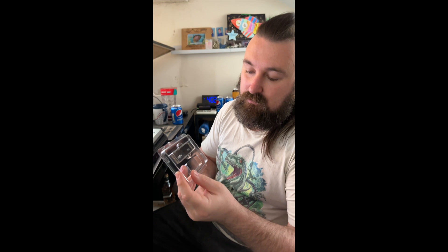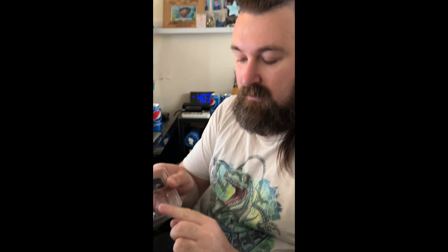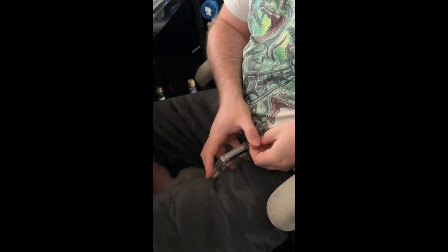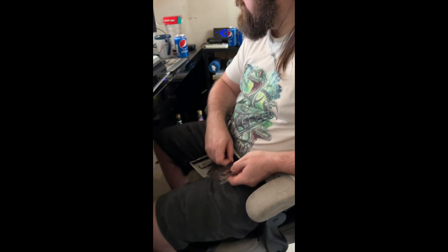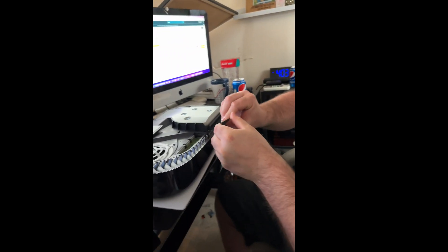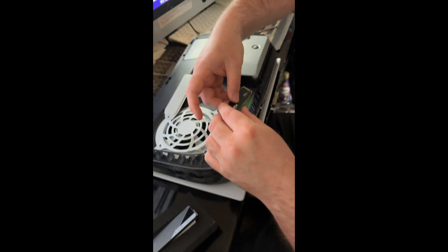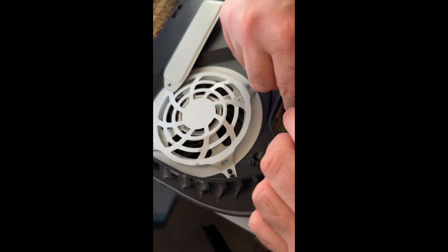Here's our Crucial 4TB M.2 SSD — ultra fast. It's got a little screw in there, so we need to make sure we don't lose that when we open it. We open it very carefully and make sure we keep this screw super safe. Now make sure we're grounded again. Now we take out the SSD and slide it into the SSD port on the PS5.